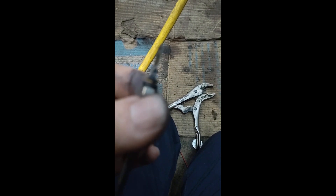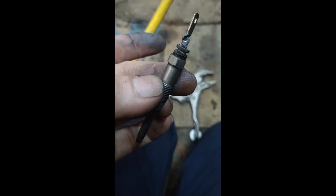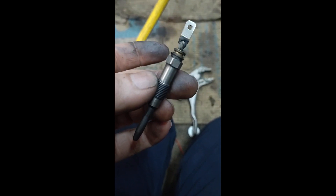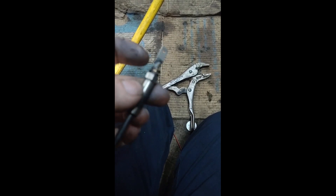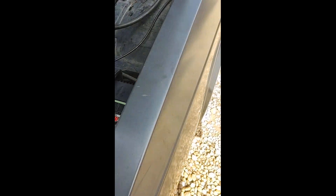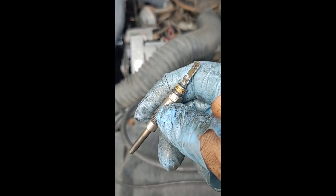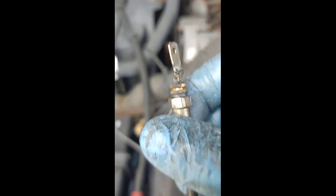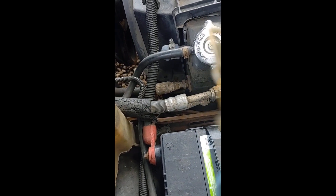They put a lot of technology into the glow plug itself, but they use the same glow plug in several different vehicles and just put a different end on it without much care. It's really too flimsy. The one I fixed originally I put on the front one because it's easy, but then I found myself welding another one and did the back one as well. I actually put a vice grip on it to test it and it doesn't move - this little cheap thing they do here is horrible.